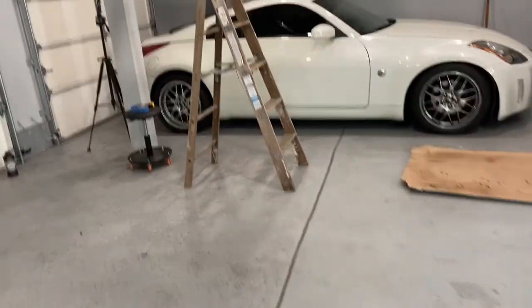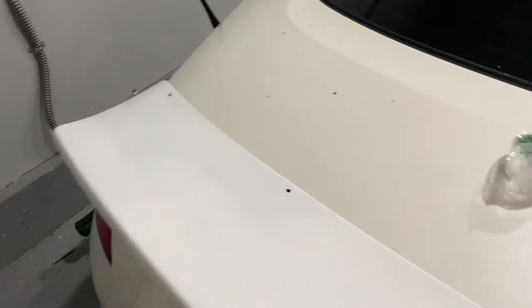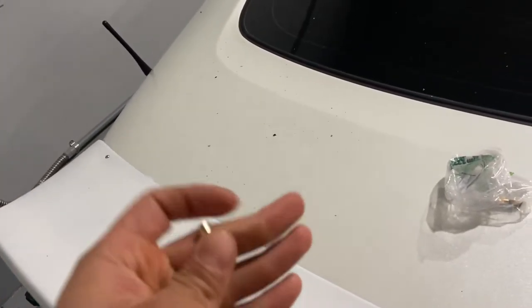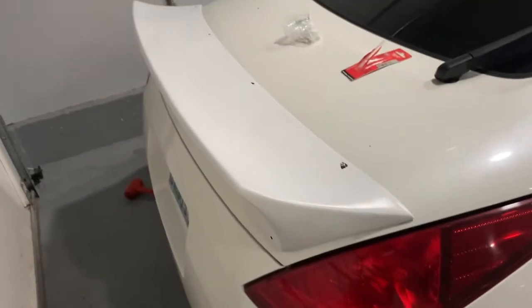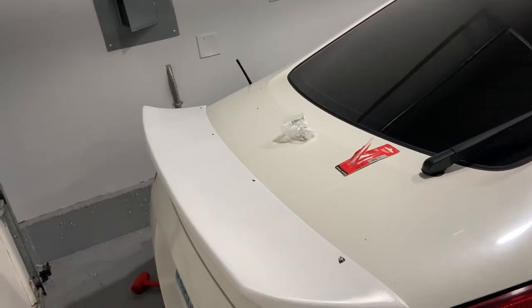We made one hole so far, but the rivets are just too tiny and cannot connect both the wing and the chassis. So instead of using regular rivets, I'm actually using rivet nuts. Basically you drill the hole in the chassis, stick the rivet nut in, and put in a bolt and it just screws in. I want to do that instead of actual rivets because it kind of makes the wing permanent — with rivet nuts I'm able to take the wing out whenever I want.